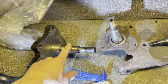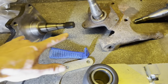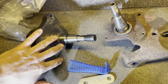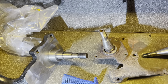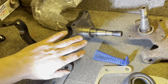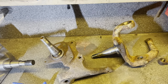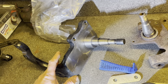Believe it or not, the spindle is the same on a late bay or early bay. The problem is the offset from certain mounting points is a bit different, but luckily they've made them close enough that you can make an adapter. I'm working on getting those done so you can bolt on your early bay brake plates on this spindle. The stopping power upgrade isn't a bad thing either.